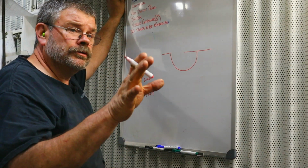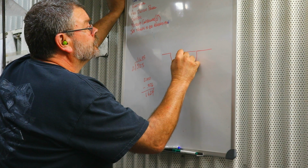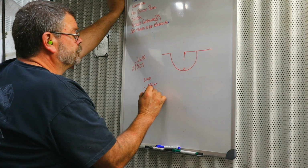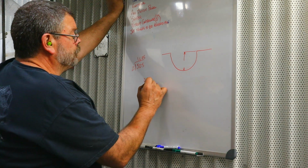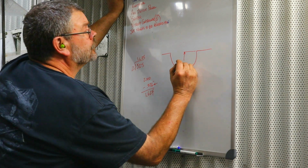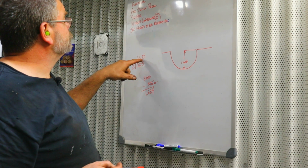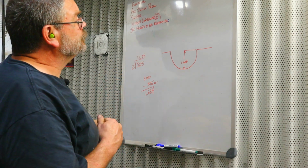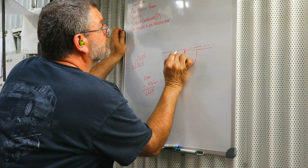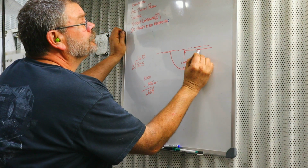Alright guys, so when we use the depth gauge to determine this distance here, we saw that the gauge moved 0.376 inches shorter than the 2 inch. Doing simple math, that comes out to 1.624. We know that the housing is 3.25 inches, divided by 2 is 1.625. So the axle center line is 1/1000th of an inch further back.